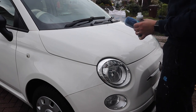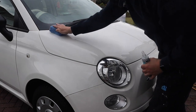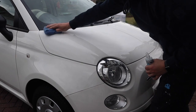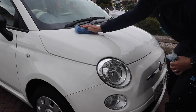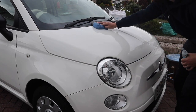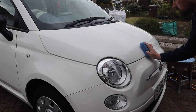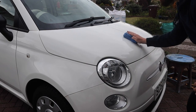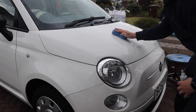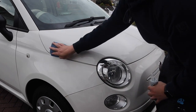Synergy Light comes in a 100 ml bottle and from that you can expect to coat three, four, sometimes five cars depending on size. As you can see here I'm doing a Fiat 500 — this was the third car I coated using this product. I'm using a pipette because the trigger sprayer crystallized within the trigger spray head and became unusable. Infinity Wax do sell replacement trigger heads, but it's something to be mindful of if you plan on using this product over a prolonged period of time.